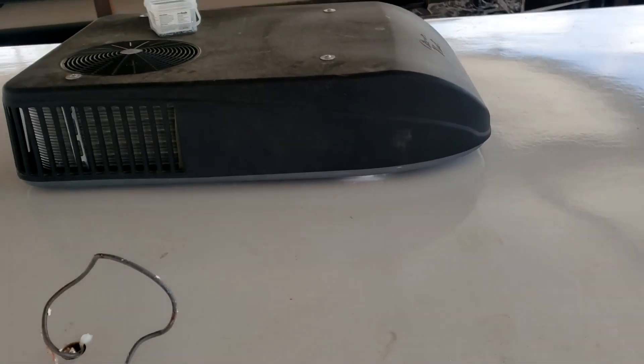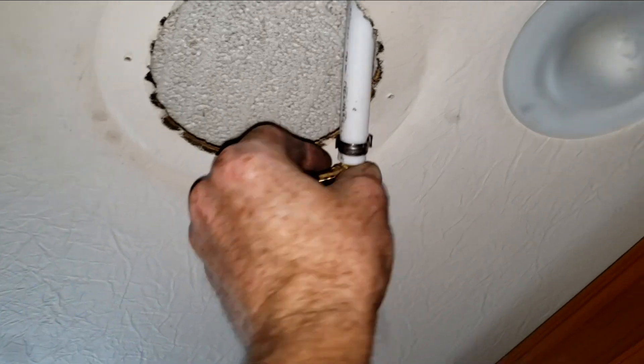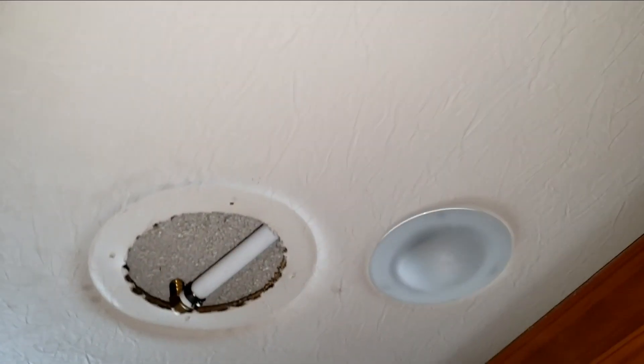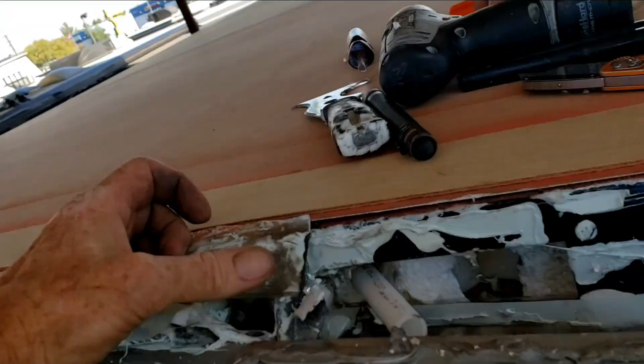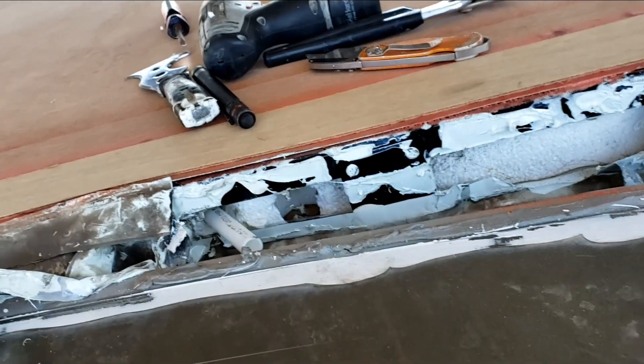There it is installed - you can kind of see my aluminum tape blending in there. The AC is back installed. Going back inside to take a look: here's our condensation line going in, we're drilling our hole. There's one end of it. This will be the only section in the actual ceiling but it'll be accessible and serviceable if it does break or leak. The other end is right behind the rear cap. Here is the other line going right into that, so there won't be anything exposed, no fittings inside, and it's all accessible. Good plan, right Chad? Absolutely.